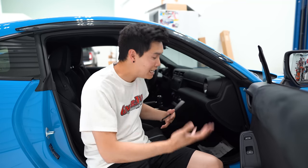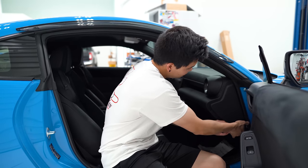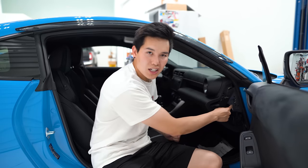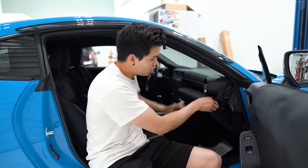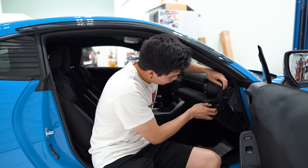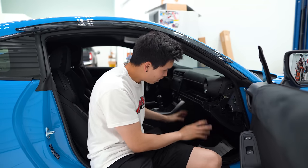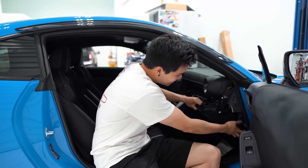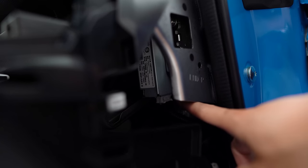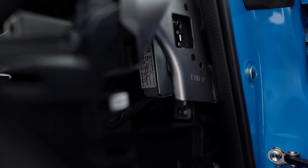You may have noticed some unnatural sounds coming from your speakers — that's fake engine noise being pumped into the cabin. If you look on the passenger side and remove the plastic trim panel, there's actually a small metal box underneath that controls all of that. We need to unplug that box. I'm going to take the dash apart to get a better angle — make sure everything is properly removed before pulling panels so you don't break anything. Look for the metal box labeled Active Sound Control and unplug it — now you won't have to deal with those fake engine noises anymore.